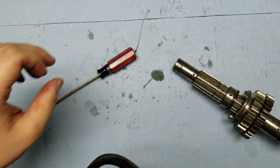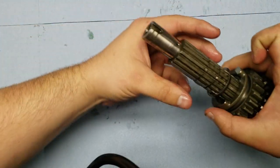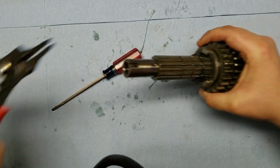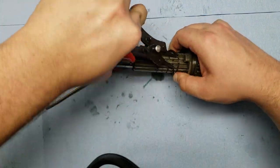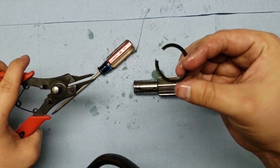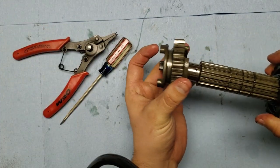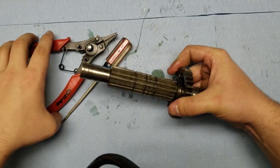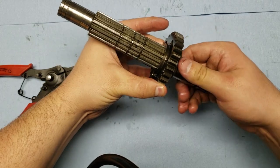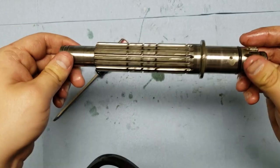And then you also have this second gear wheel. After that you have another tooth collar on here — again, looks like a little oil gallery. Then you have another tooth washer. Then you have another circlip on there — I'm going to have to get the snap ring pliers to get this off. If your snap rings are starting to bend like this, it's probably best to go ahead and replace them. Now we have the fourth gear wheel. Another circlip. Another tooth collar. Then you have the reverse wheel gear — take that off. And then you'll also have this collar on here, which is not a tooth one, it just spins on there. And that's the entire drive axle disassembled.